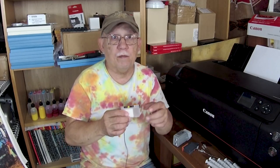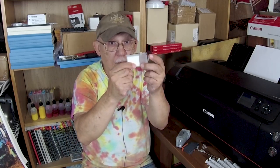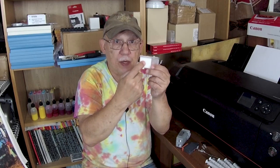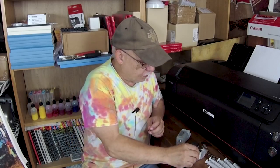Why would you want to do that? The domino effect. As you continue printing, all the ink colors are used at different rates, so you're going to have varying levels of ink. What you don't want is: a cartridge goes low, you reset it, refill it, pop it back in — and then another cartridge that was almost low becomes low, because of the purge cycle that is generated. You remove that cartridge from the printhead, and now there's a perfect chance of air getting in — that's why it has to be re-purged or re-primed. So fill them before they are low, or right at the point where you get that low warning, to prevent the sponge from losing its level of saturation. You want to avoid that like the plague.